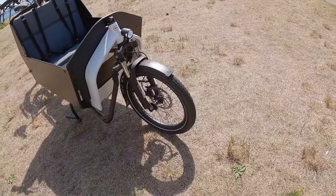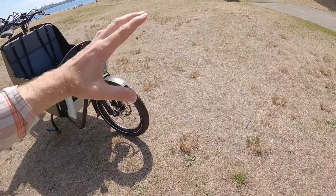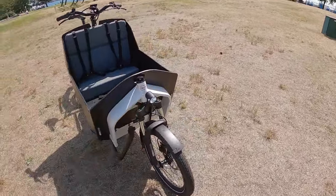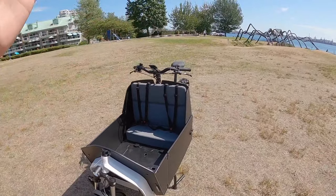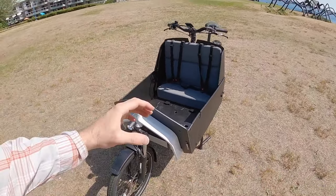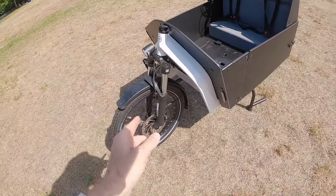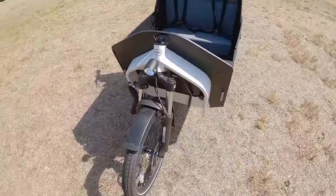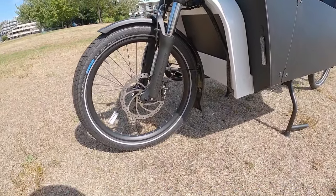With smaller wheels like this and tires, you get a higher attack angle that kind of runs into bumps and falls into potholes a little bit easier, so it can be jarring. Really nice to have that suspension fork. It does introduce some slop and play into the whole system. And again, the bike's heavy and the whole thing can start to feel a little unwieldy unless it's fairly stiff. So I like that it's a sturdier axle, kind of a through axle up front versus a 9mm skewer.